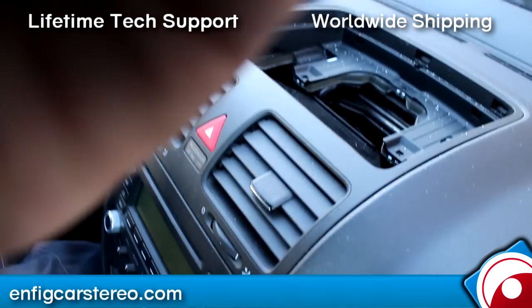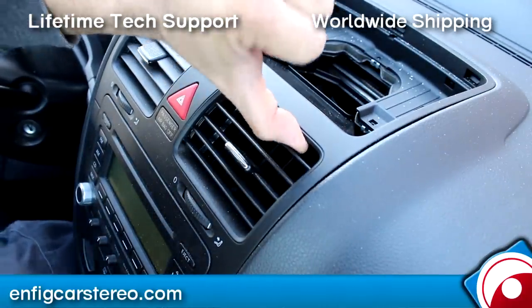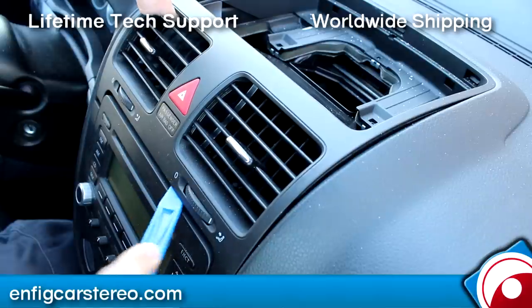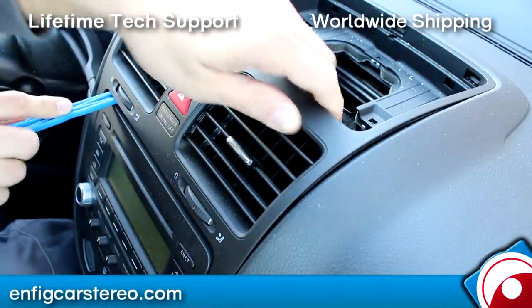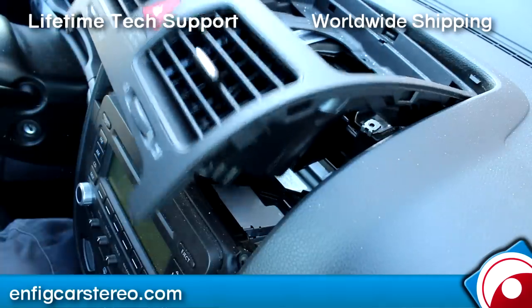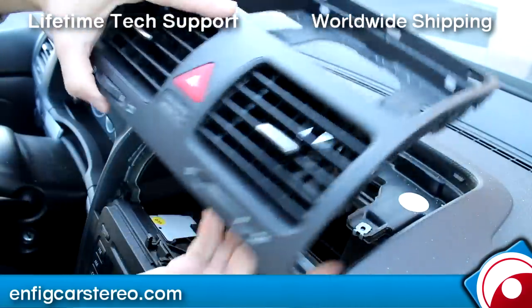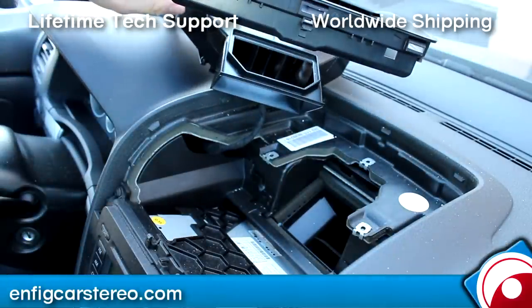This is where my video differs from the other ones I've done. At this point I used to pry from back there, but now what you do is put your finger here — not on the vent, you're going to break a vent if you do. Pop it in there, do the same thing on the other side. In the middle you're going to see a little plastic bar going up and down — just make sure you get above that plastic bar and pry up. It comes right up just like so. Grab the panel and put it sideways. You can unplug it, but the problem is there's an airbag light here. If you disconnect it and turn the car on, you're going to get an airbag warning light, so don't do it.